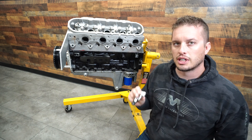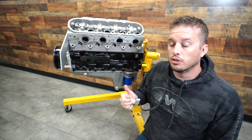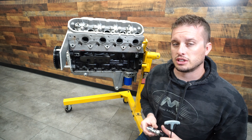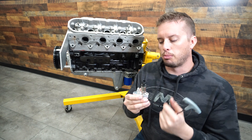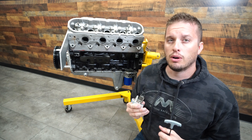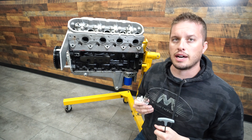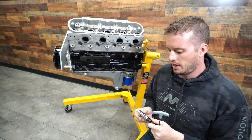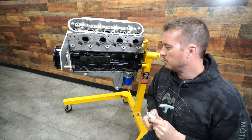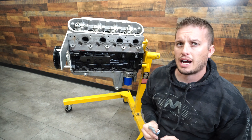If you're in a factory application or running an aftermarket electronic oil pressure sensor going to the factory computer, the back-of-engine port can definitely prove difficult, which is why we made this machined block. It bolts right to the location above the oil filter on any LS engine — there's two little ports and two screw holes. The block is wide open in the back so oil comes directly from the filter — freshly filtered oil on its way up to the oil pressure sensor. It's a 1/8" NPT block with two ports. Single turbo setup: you can run one feed and your oil pressure sensor, or twin turbo: run one fitting to each turbo instead of having a T in the middle of the line. It reuses the factory gasket and gives you a lot of flexibility without hunting for adapters.